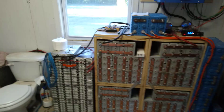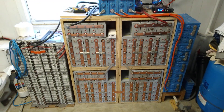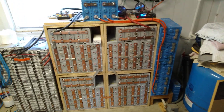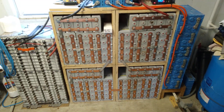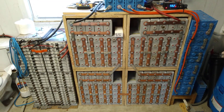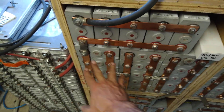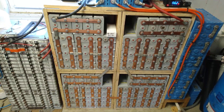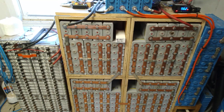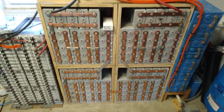The other thing I've been doing — a little less exciting maybe — is I finally got all my batteries installed. Under that towel is a full Nissan Leaf pack, that one's about two-thirds of one, another Nissan Leaf pack, and these are 80 of the 90 cells that were in my Ranger. The blue ones were out of a different conversion. We had a lot of sun this weekend — gorgeous weekend — so this was able to get fully charged. I sat on my little roller cart and monitored every string of five cells — there are 16 strings — and measured voltage as it increased to full charge. If any of them got over about 3.6V, I'd put a resistor on it and drag them back down to about 3.5V, and just work my way around.